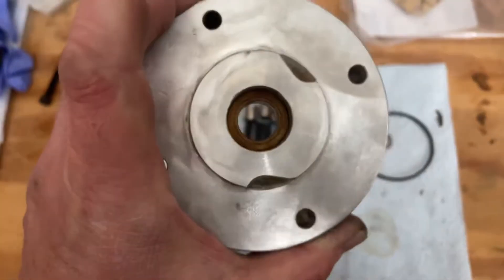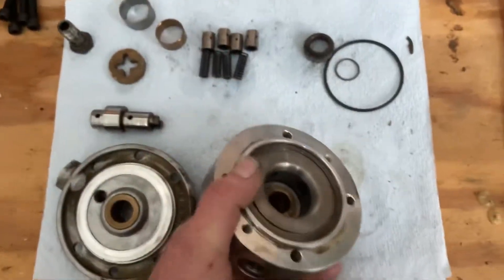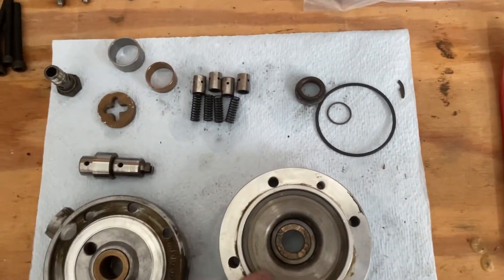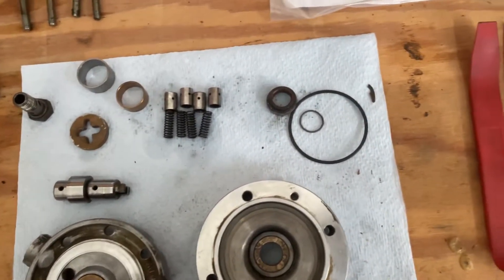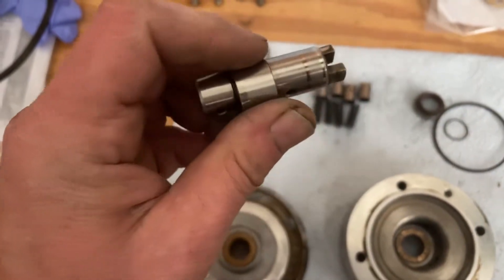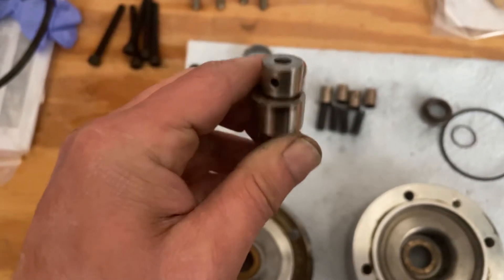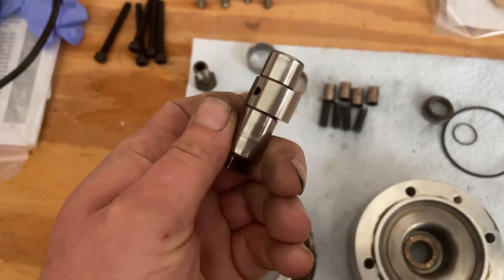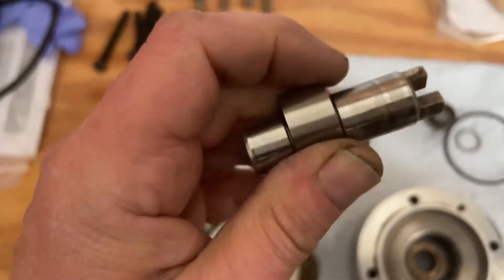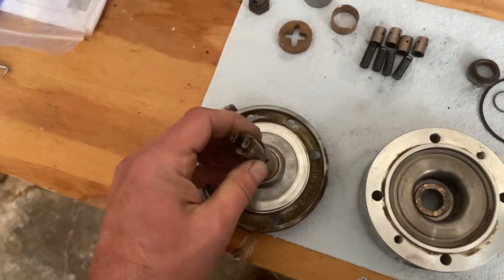So I polished the whole thing, got it off okay, and on the back side I'm just going to sit in the new gasket. I'm not going to take the inner part out on this unit, and the reason for this is the shaft here — the coupler or the pump mechanism — is actually in good shape because it is not scored, except it has some markings from where the old front seal was, and that sits in here like this.